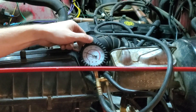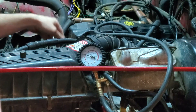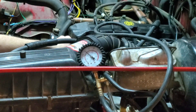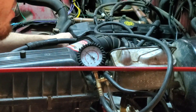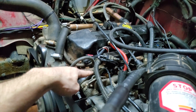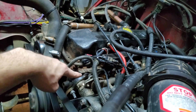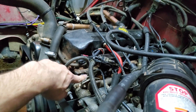At idle we're right at 30 PSI. And this would be the maximum fuel pressure condition, which looks like it's about 38 PSI. All we're doing here to create that maximum fuel pressure condition is removing this vacuum line. This is your pressure regulator, that's your fuel rail, and when you remove that vacuum line, that's when it spikes in pressure.